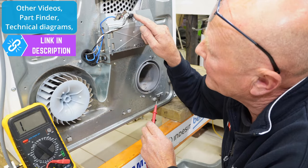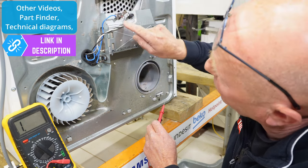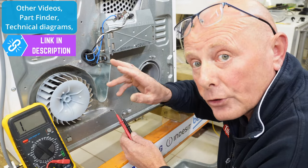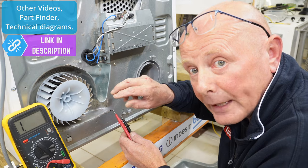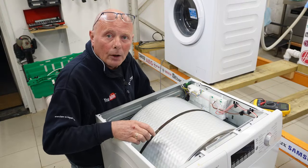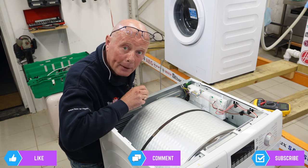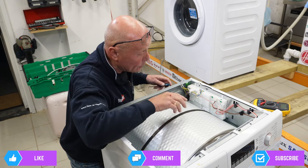The next thing we have to do is check the NTC sensor. The NTC sensor is connected via two small black wires that go through to a plug. From experience, having done a complete strip-down of this machine, I know that it goes into a connection block and then the two black wires join to a plug which then become two pink wires. So we're going to go up to the top of the programmer to test the NTC sensor. The two pink wires come up from the back and go all the way through to the programmer connection point.